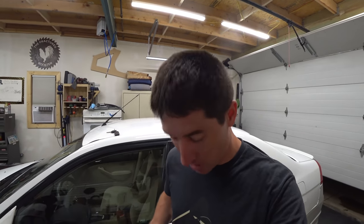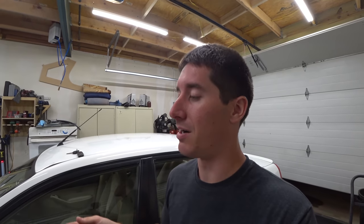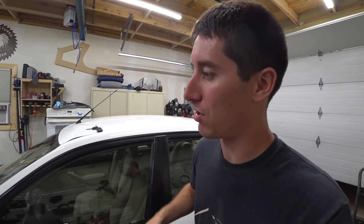That is it for today — thank you so much for watching. Head on over to shop watchjrgo.com for cool shirts. Also the 12-volt battery is bad too, which could contribute to more of our issues. On the jump pack the thing was working really well, but then we put it on the charger and saw a crazy current draw and the charger leads were so hot we could barely grab onto them. So it's going to get a new 12-volt battery tomorrow no matter what.